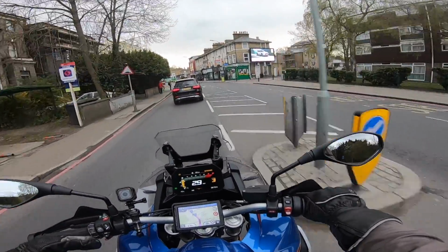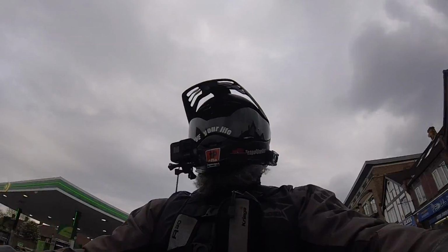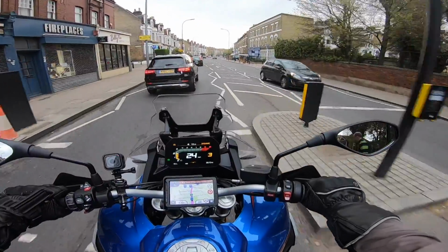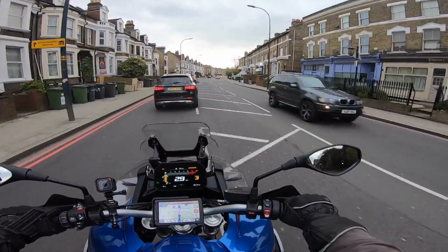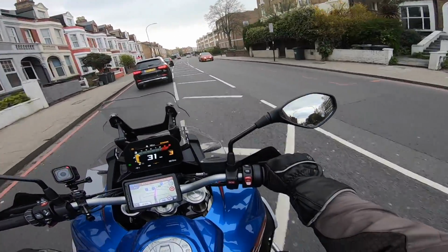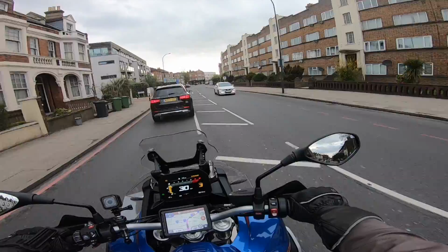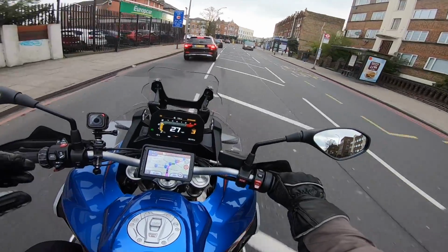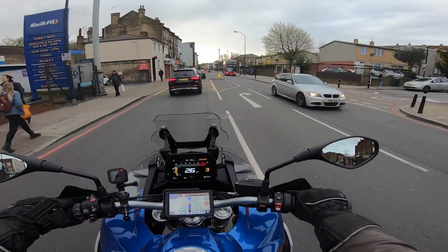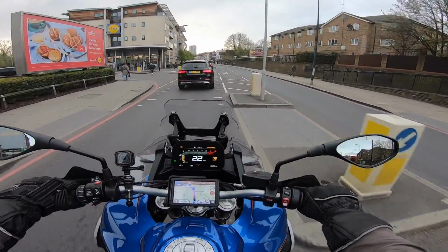people were saying that it's probably better off-road than the big 1200 or 1250 GS for them. But for me, I actually find this harder to move around off the bike than I do the big 1200. And for me, it's mainly because with the big 1200, with the big pots that you have there, all the weight of the engine, everything is right down low by your feet, and it just makes the bike incredibly stable and easy to move around. This is a bit more of a traditional engine, and it's a bit more top heavy. This one takes a little bit more effort for me to move it around. Still not particularly difficult, but it's certainly harder than the 1200 for me.